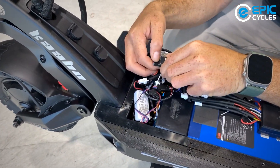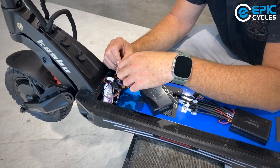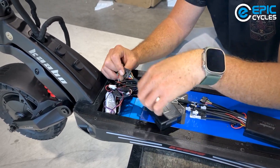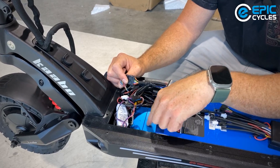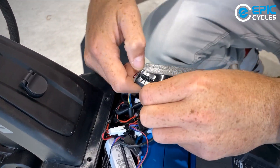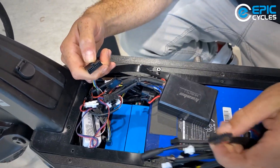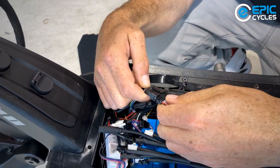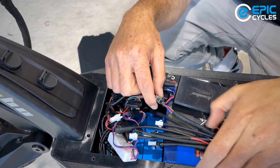Let's start with this one over here. You'll get better access if you just remove the light module a little bit. You'll see here are your controllers — what sits on top of the controllers. To remove this plug right here, you're going to want to press down on this clip here and then it simply comes out. Let's take the new one and plug this one in. You'll want to hear a snap — once it snaps in, you know you're in.